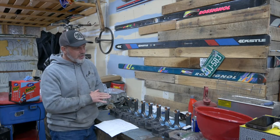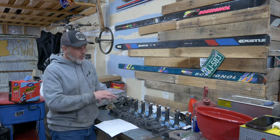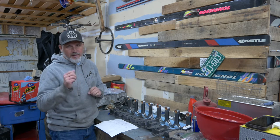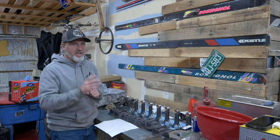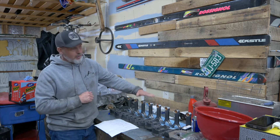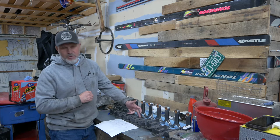Now that we've gotten everything back from the machine shop, I talked to them and they said it doesn't matter what order the pistons and the rods go in — that was wrong. After weighing everything with my scale, when we're talking in grams we're not talking that much weight, but in a rotating assembly every gram is important. Some of these pistons weighed in excess of two grams different from others. We also had pins that weighed in excess of two grams different from others.